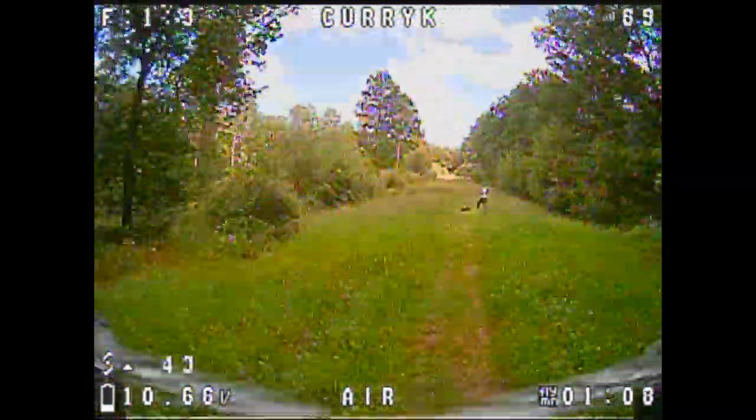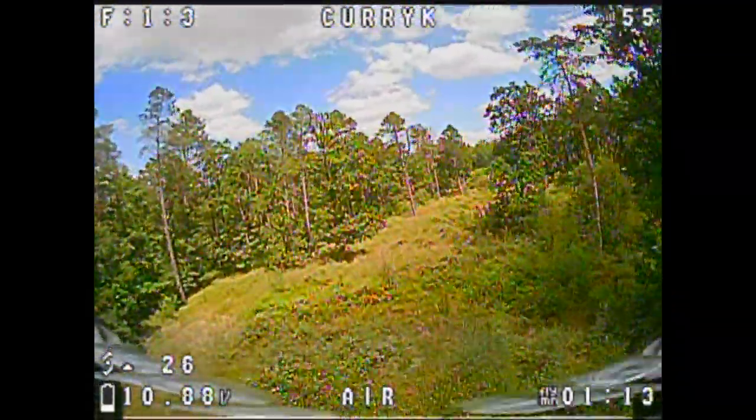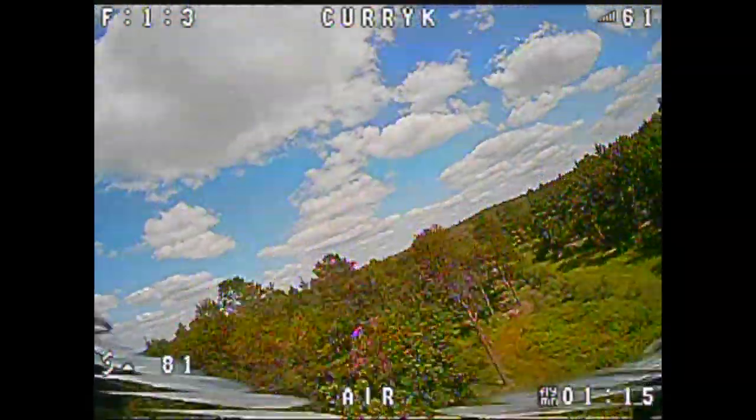I also went back and did a quick test on a 3S battery — one of the little high-voltage 300mAh 3S packs I'd normally use with the other Toothpick-style quads or some of the cinewhoop type things, so generally quite a high-C battery. But the KV on these motors isn't quite as high, so we're having to use a lot more power. It flies absolutely fine on 3S, it's just not particularly exciting because I can't get that crazy speed and power. I think the KV is really designed for 4S. It's okay if you want to fly casually and you haven't got many 4S batteries.